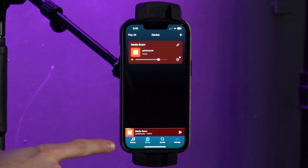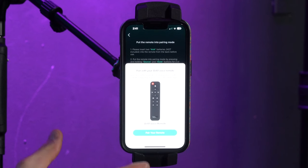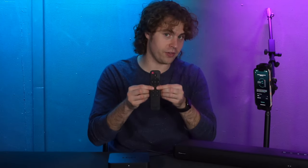Along with the WIM app you can also use the WIM remote to control your WIM Pro. First, get a pair of AAA batteries and plug them into the remote. Then go into the device tab of your WIM app, go to the settings icon, and click the remote tab. You'll get a prompt to pair your remote — click on it and the WIM Pro will begin pairing. If the prompt doesn't appear, hold down the source and mute button together for about two seconds to set the remote to pairing mode, and then finish the setup from there.